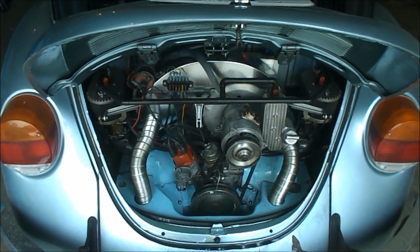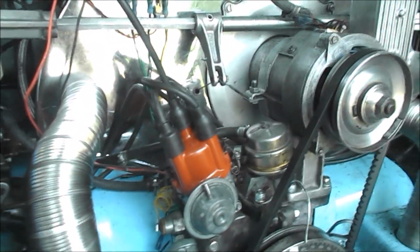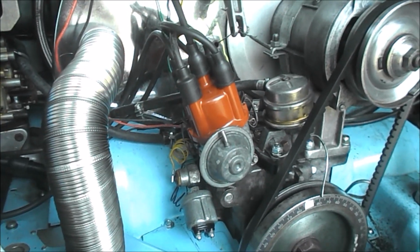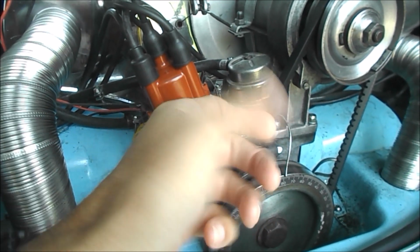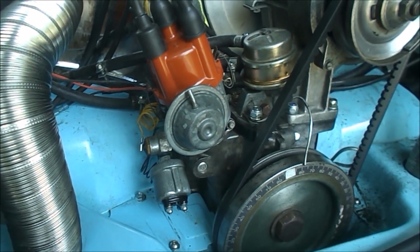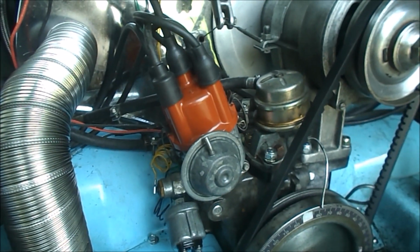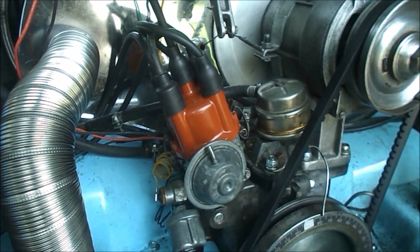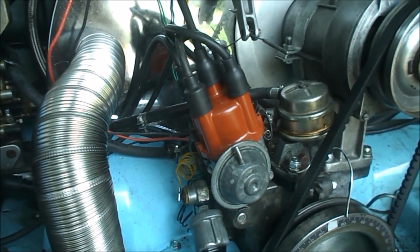Not bad. Well, took it out for a little drive, I think that was 2 evenings ago, and it was still bouncing around a little tiny bit. Now, I know there's nothing wrong with the electrical connections up here. This is all solid. But there's one other electrical connection that you kind of forget about when you install it, and that's ground. So it's entirely possible that that little screw that holds this thing together has come loose. It's a tiny screw if you've ever seen one of these things, and when I put it together, I sure didn't want to strip that thing out. So I may not have torqued it down enough to keep it from undoing itself. And if that's the case, it matches the symptoms. It worked fantastic when I first put it together, and there was a slow buildup of problems over time. That's consistent with the screw backing out slowly as the engine vibrates. So I'm going to pop it open and see if that little screw has come loose.